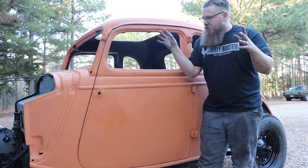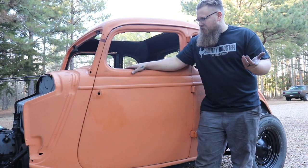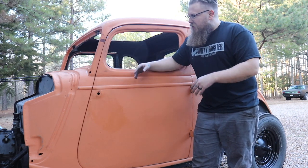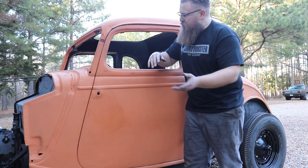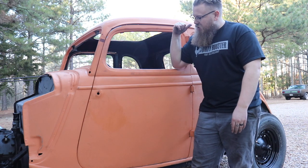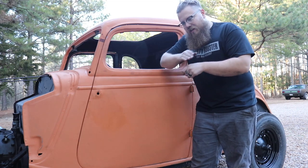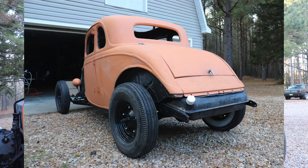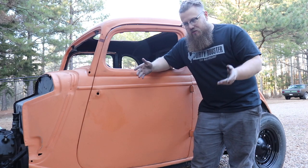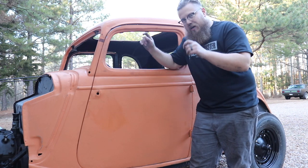This car is just a bunch of pieces of stamped metal welded together — that's basically what most cars are. It could be under tension, it could be pulling itself together, it could be pushing itself apart. You could cut this roof off and the door will spring open, or maybe it will just stay in place. But one thing is for certain: if you cut the top structure off, the bottom structure has less support. It's like square box tubing — if you cut one side off and still have all the same weight pushing and pulling on it, it could bend because it's no longer square. That's basically what we're doing when we cut the roof off.